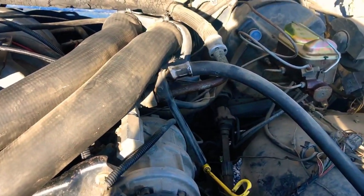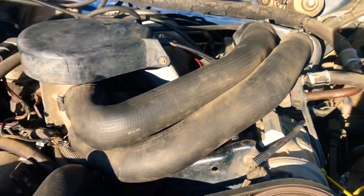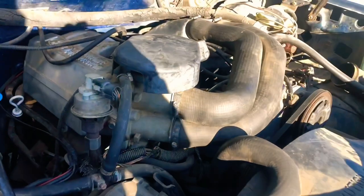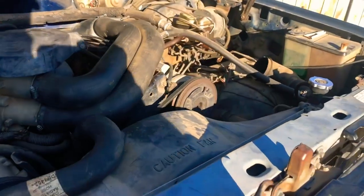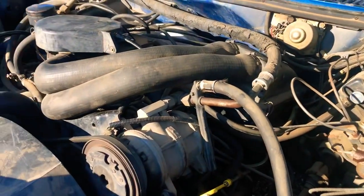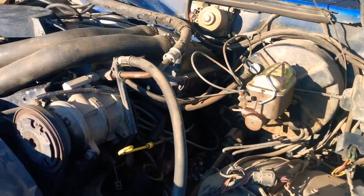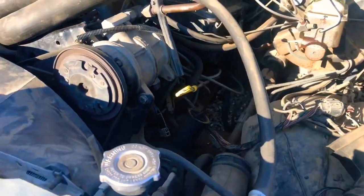It's got the transmission in it — an overdrive AOD transmission, which is a good transmission. The problem is it slips; you've got to rev it up to get it to go. Underneath it's all painted up and really clean, so somebody may have either just taken it out and painted it or it might be a remanufactured one. All the vacuum lines are complete. This thing has basically been kept completely stock its entire life. The story goes it has a remanufactured 302 — the previous owner ran the oil and took it to Ford, and Ford put another motor in it, so this isn't the original engine. The truck shows 46, so it's either 146 or 246 thousand miles. It's also got a new brake master cylinder.